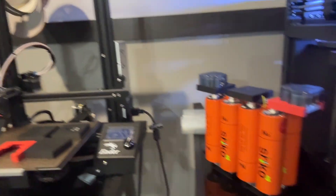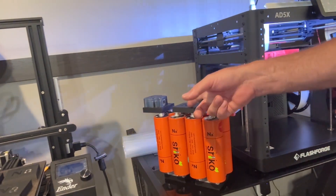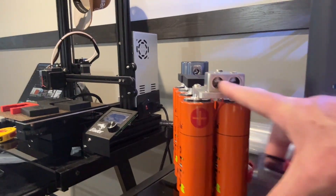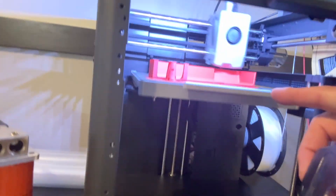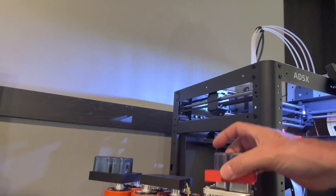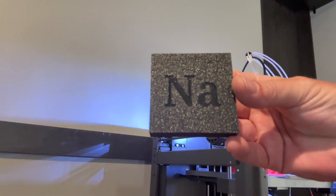As you can see right here, I've got it sitting here. I've 3D printed some covers — nice and tight fit. I got the scar bus bars, so the scar bus bars fit here and that'll give me a 1 in and a 2 out. This will run from the battery up front to the amplifier. We got the 1 in, 2 out, and then this is the positive side — red 3D printed covers. I put the 'Na' on there for sodium.